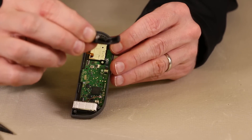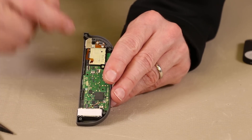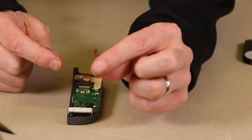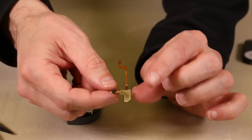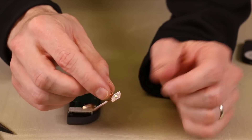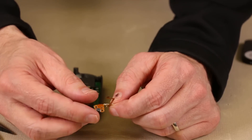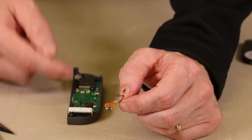And there you have the button with the spring on the end. Now it's time to remove the actual physical buttons — and now the buttons just come right out. If you ever have a problem with your minus button or your L button not working, there's a good chance that these physical little buttons right here have just gone bad. And as you can see, they're fairly easily replaceable, as you can just get a new ribbon cable with the buttons and reinstall it into your controller.